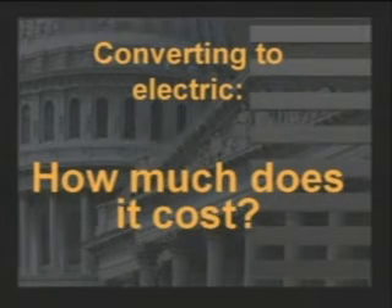The batteries in this car — 1,350 pounds of batteries — are equivalent to about a gallon and a half of gasoline. This conversion is a $13,000 conversion, probably on the cheap side. Most people that convert a car for you will charge a little bit more. This has everything your gas car has: a heater, good brakes. It has a range of 60 miles. This is lead acid golf cart technology — basically the same batteries we had 70 years ago. The newer lithium batteries aren't cost effective right now. As for charging: on 220, it's about four hours; on 110, it takes about eight to ten hours.